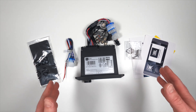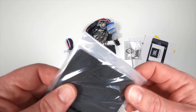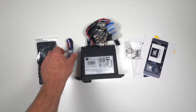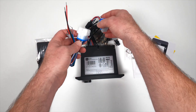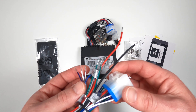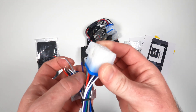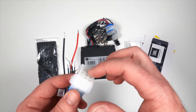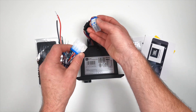Here's everything in the box, starting from left to right. On the far left, there's an included foam seal that goes between the backside of the head unit and the mounting surface, giving it a watertight seal — that's what helps give this its IPX7 rating from the front. Next, you've got the wire harness that plugs into the back of the unit. This is a water-sealed harness — unlike a traditional one for a car head unit. It's pretty well sealed and will help prevent corrosion, water intrusion, and short circuiting. You can see there's a seal right here, so when you plug it in, it's watertight.